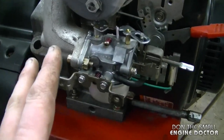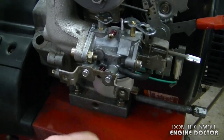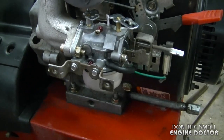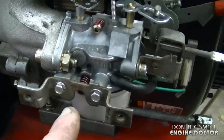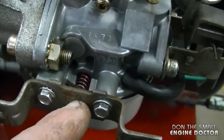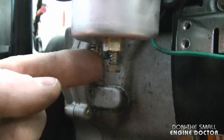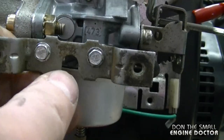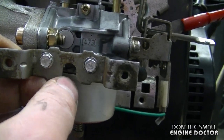What I mean by getting better results is that you can adjust the carburetor if it's not quite running the way you want. Non-adjustable carburetors will often starve for fuel, surge up and down, or make popping noises. With the adjustable carburetor, you have an idle air screw on the side and an adjustable screw on the bowl nut underneath. Usually one and a half turns out is good for the bowl nut screw, and approximately three quarters to one turn out for the idle air screw.